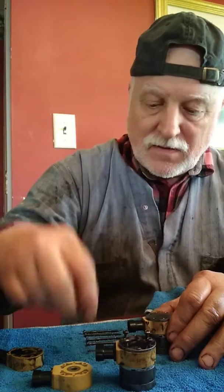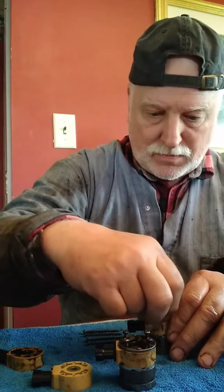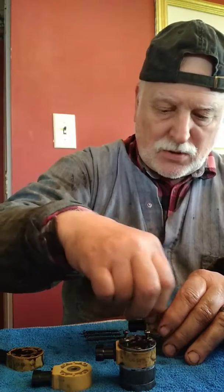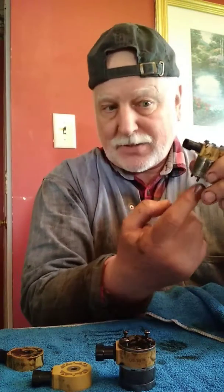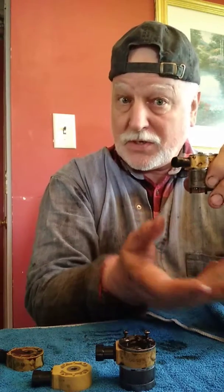You want to see the mess I had the first time I did this — that's why I'm making this video, so you don't have to mess up. Don't make that screw tight because the whole thing's got to move around a little bit. Get your long screws — those screw into the motor. Get them all in place; don't turn it upside down or they'll all drop out. Some like mine have an extra little plate on the box and sometimes that'll come up off the engine with it. You don't want to drop it down in the motor because the oil will stick it, especially if it's real cold.